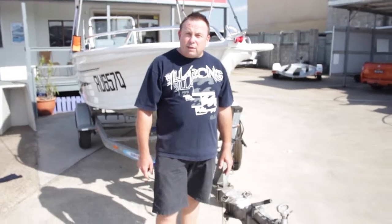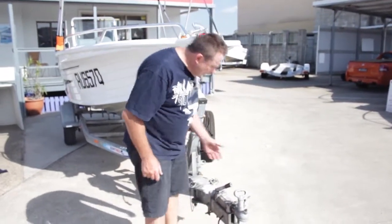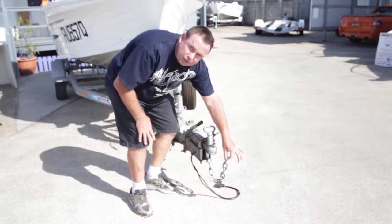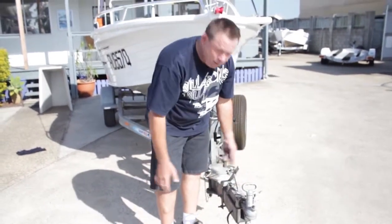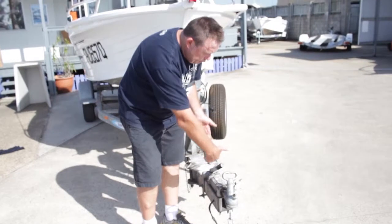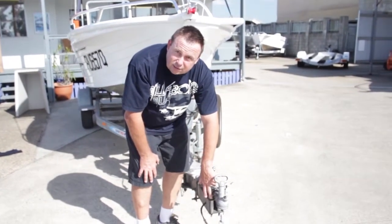Once you've done all your pre-checks on the boat, it's wise to have a look at the trailer. Make sure when it's hitched on to the car that you lift the button up and confirm it's locked down — I always like to lift up and double check that it's nice and secure. We run a safety chain — always make sure it's got a nice shackle to a fixed point on the car; the law says you must run a safety chain. We have a braking system on this particular trailer. You can use a park brake at home, or flip it back. When the car slows down, that pushes back and activates the brake. We have a reversing lock to stop the brakes being applied when backing up a hill.